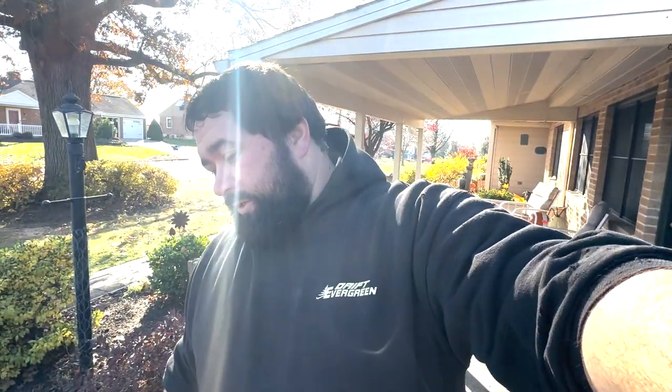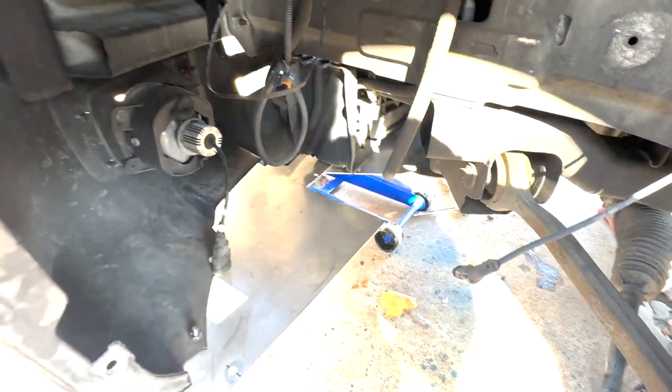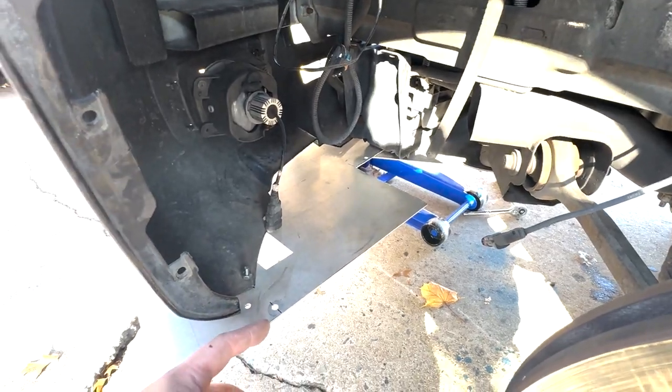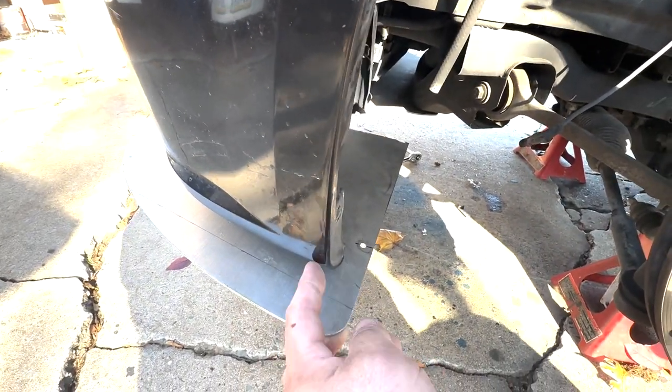It's a little work. Now I just need to figure out the holes for the middle bit, trim the back up so that it's flush with the bumper here — right now it's sticking out and in. I also want to trim a little bit in here, and I just want to make sure that clears the tire. I'll put the fender well back in just to make sure everything lines up. I'm at least going to trim an inch so that it lines up real nice right here.